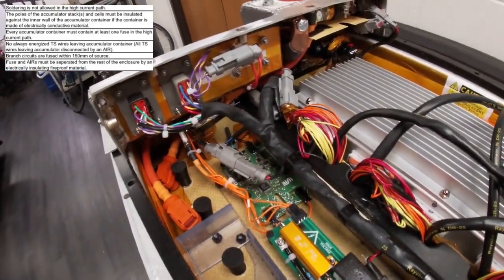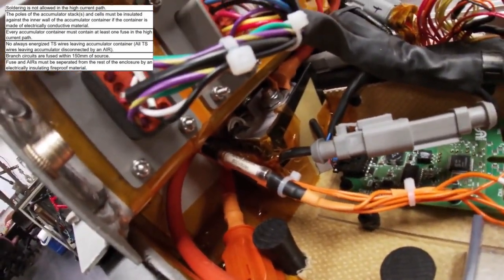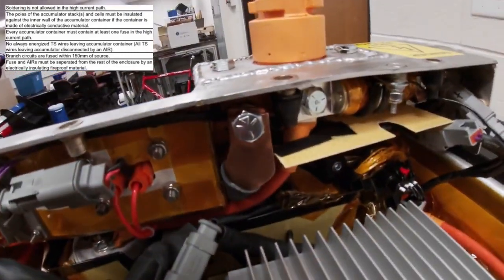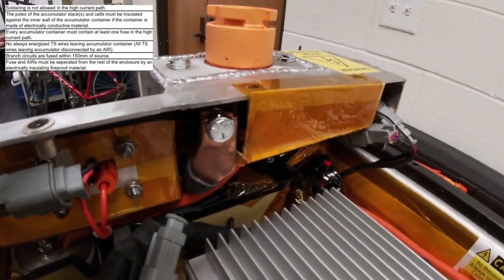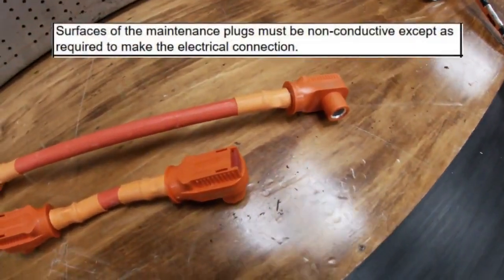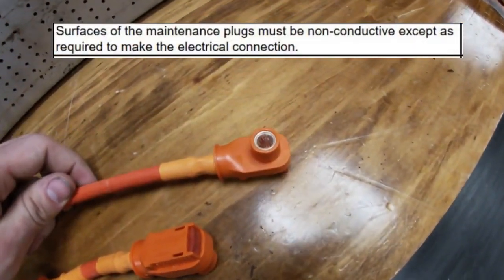Now that the lid is installed, I can show you the secondary isolation between the contactors and the rest of the battery pack. Here you can see the negative contactor, and the nylon lock nuts tightened down with several threads showing on top. Here is the other contactor with a lid just made of Kevlar. There is the fuse with the bottom portion of the secondary isolation, and here you can see the second piece of Kevlar taped around the fuse. Here are the female radlock connectors, and you can see that all surfaces are insulated except for right where it slides over the pin.